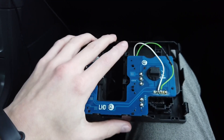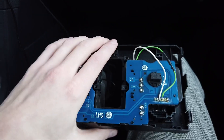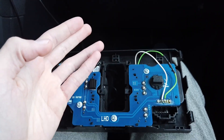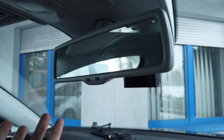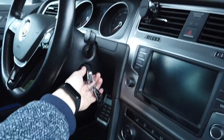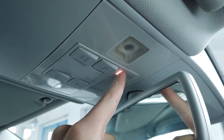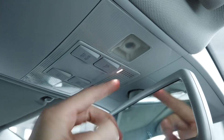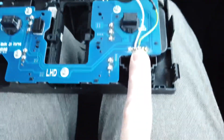The 7.5kΩ resistor is there to limit the current going to the LED and make sure it's dim enough for the ambient illumination to make sense. If this LED was too bright, it would distract you and cast light on the rearview mirror, which is not a good idea. Right now, let me just turn the ignition and you can see we have some light over here.